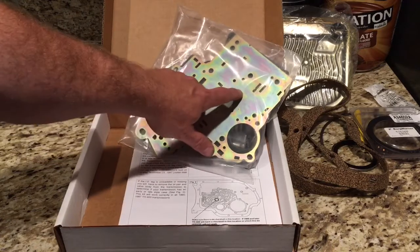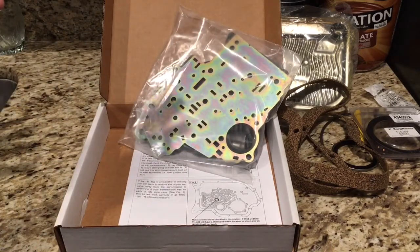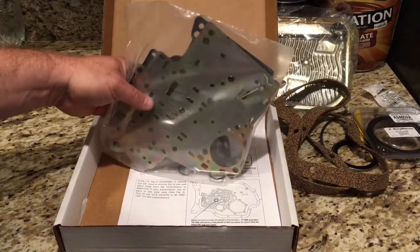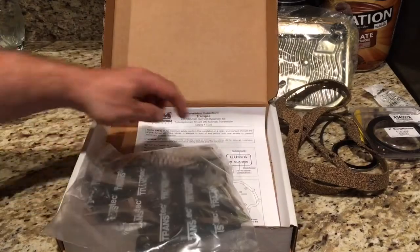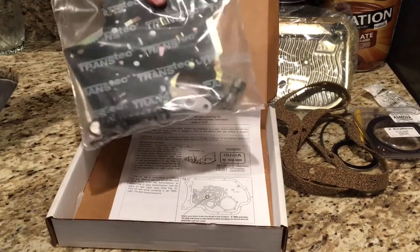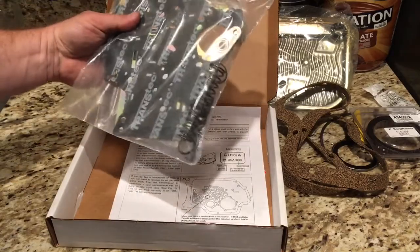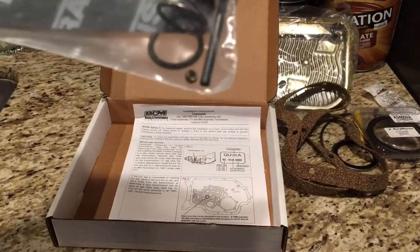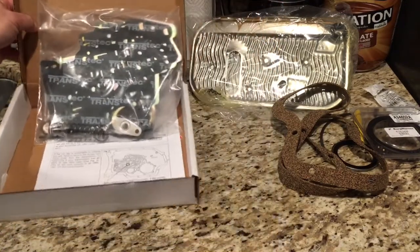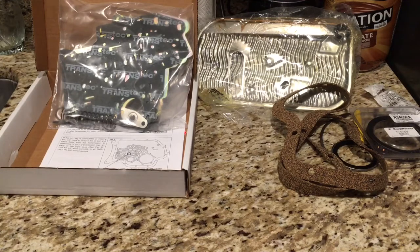There's no reason to have these holes super big because all that's going to do is cause problems. Because that other separator plate was drilled out to some ungodly size, I needed a new separator plate. The kit comes with the 1-2 shift valve and that little brass plug to plug the exhaust hole — it basically just hammers in until it's flush and you're good to go. Go to the crankshaft coalition website — I'll try to put a link in the description below. It has a recipe that goes step by step.